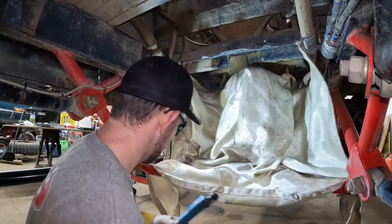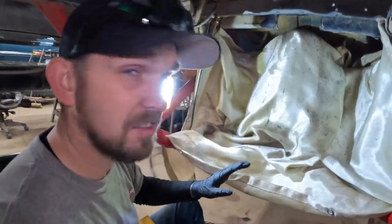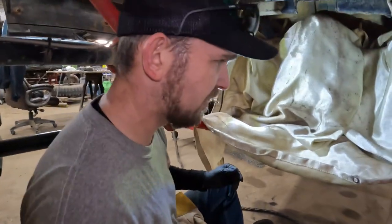And it's out. Real quick I just want to show you a stupid little thing - throwing a fiberglass blanket over your stuff is going to save you a lot of headache, because just look at all this slag that would have been stuck to my dropbox, possibly the shaft that goes through the dropbox. It helps you avoid all kinds of headaches that you don't need.